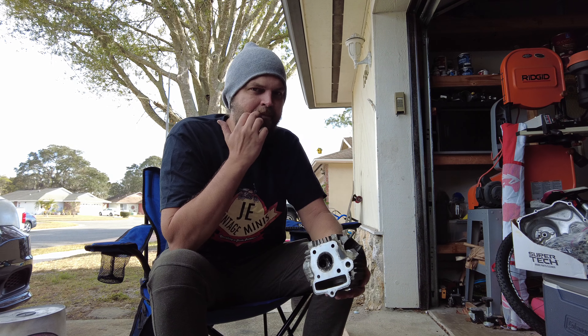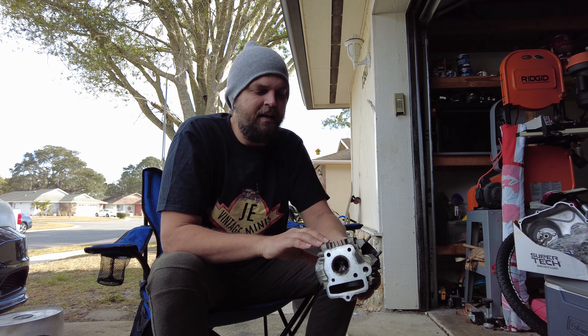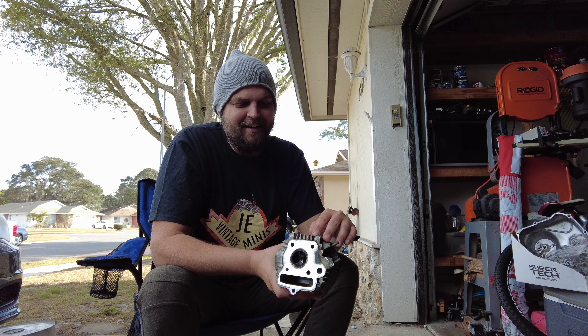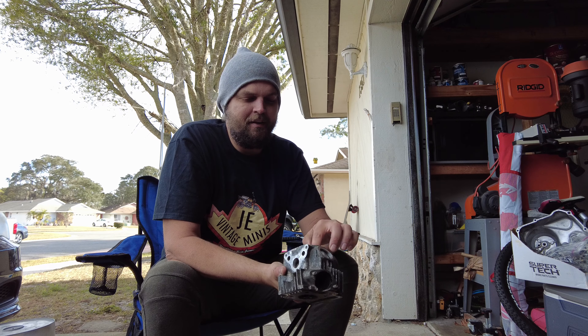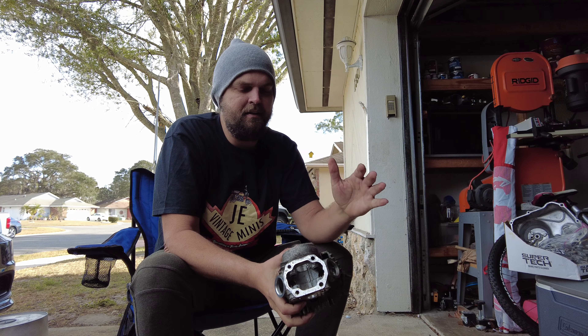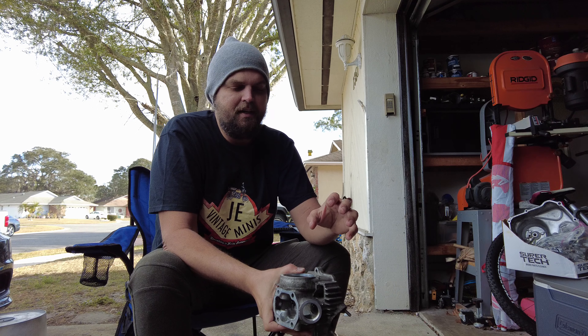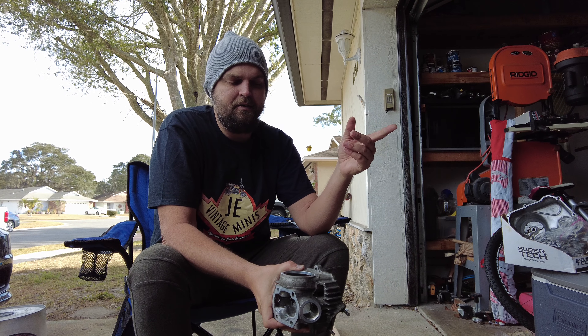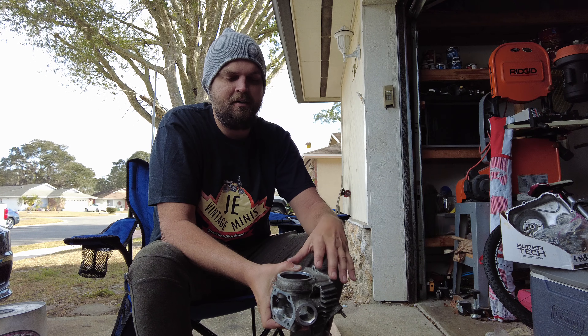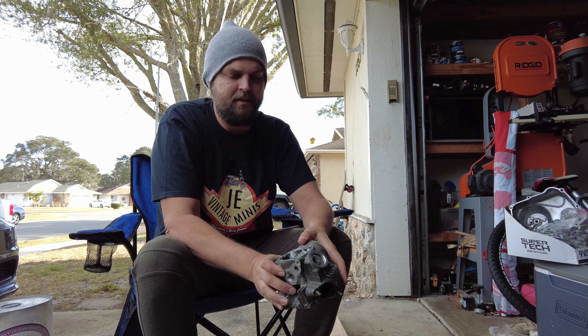Hey man, it's Josh here in Orlando. I'm with Ken over from East Coastish. We're kind of doing a collab job on his Z50J that he has, that I regrettably sold him. So we got the head here, we're just going to do a clean up on it. We did have a little hiccup with the valve coming out, but we were able to work through that and get it pulled completely. So we got our bare head here. He did a good job getting all the gaskets off. We're going to use some of my equipment to do a media blast, get the top corrosive stuff off, and then put it in the vapor honer, which will give it a nice satin natural aluminum finish. Hang out and watch us do this — you'll like the end product when we're done.